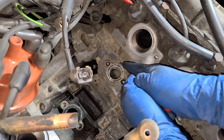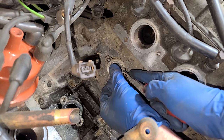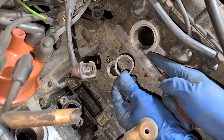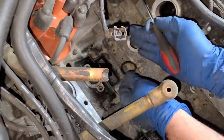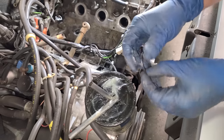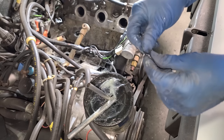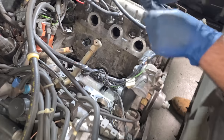So first we need to reinstall an aluminum coolant Y pipe. And we have to get out these 1981 O-rings. Nice and crusty. I'm gonna go ahead and say this is probably a big reason for little coolant leaks in this Valley of Death. Yeah, very possible these things were leaking. It wouldn't be a project without some Mercedes-Benz sunroof grease. We're gonna use that on our seals, our new ones. Seal number two, going in.